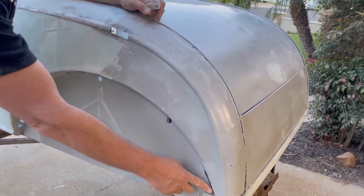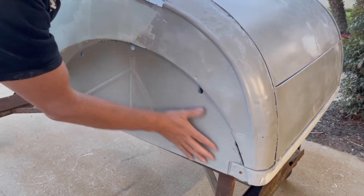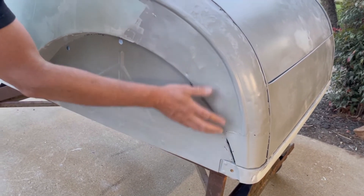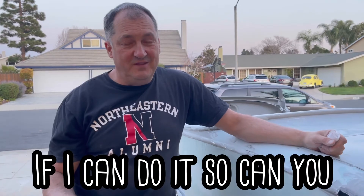I'll do some metal work here — there's a piece of metal work down here and right here as well. I had to relief cut this so I could follow this edge right up into here. This is a replacement panel that's been butt welded on the side and lap welded on the back. That concludes this video — next time I'll bring you back and take another look at this panel, hopefully in epoxy. If I can do it, so can you! If you like this video, click like and subscribe — thanks and have a great day!